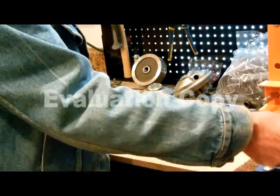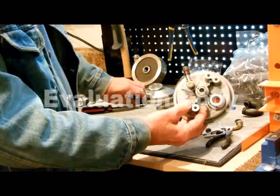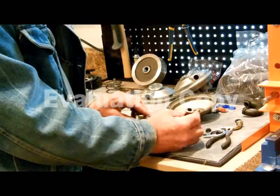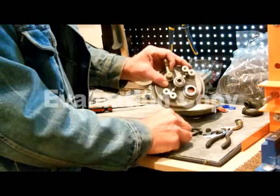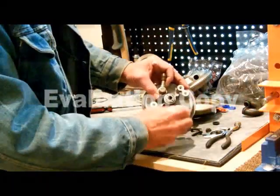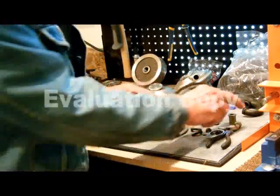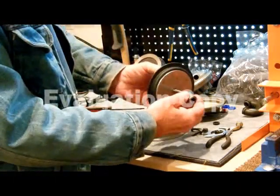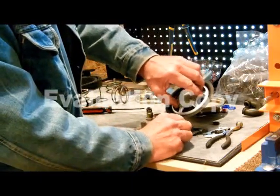On the bottom part of the diaphragm you can see it has what looks like a valve guide, and this is what that looks like removed. This guide is pressed into the bottom piece of the vacuum pump, so we have to press that out and then the new oil seal goes in. The shaft guide — not the valve guide — goes inside that, and that's what guides the diaphragm up and down inside the diaphragm housing itself.